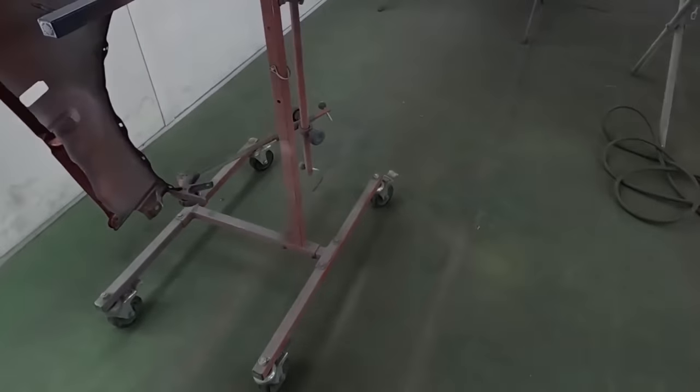You can see we're using a combination of 6 inch, 18 inch, and 36 inch white paper. The white paper is much thinner and it's perfect for painting. And when you go to cut it, like we said earlier, it does not dull that blade and it cuts nice and clean. So we want to make sure that everything is completely tight. After we put down that masking paper, then we'll come along with our masking tape.